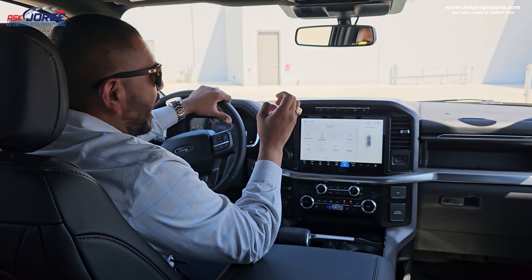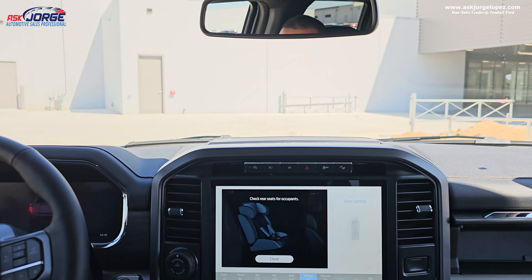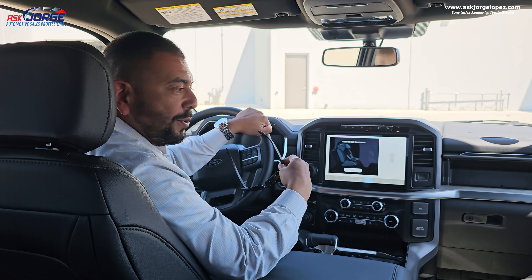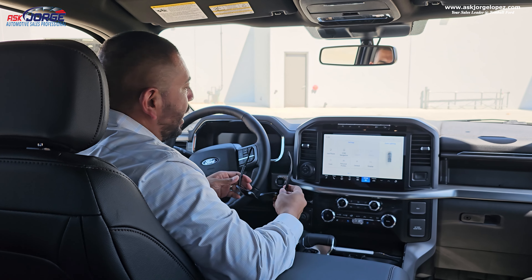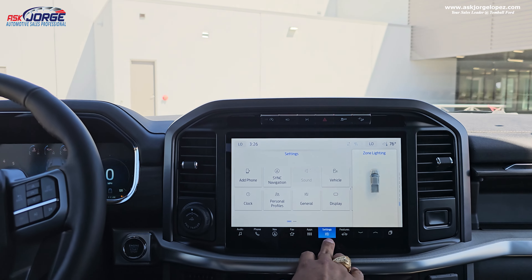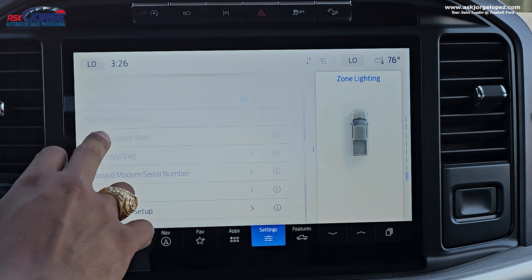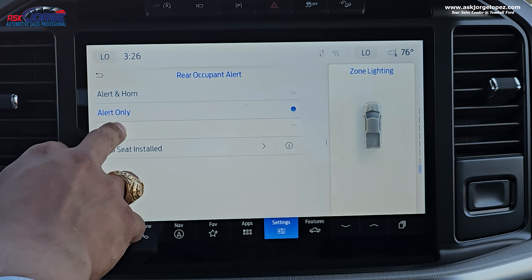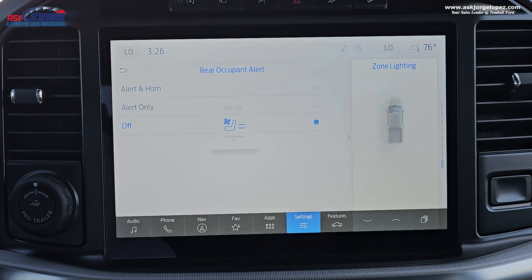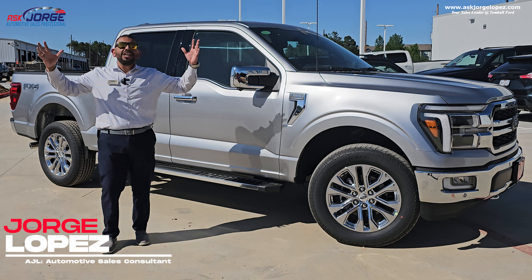There's a little tip. One customer told me he did not know he could turn off that message that appears every time he turned off his truck. The message is the rear occupant alert — the reminder to not forget your kids in the back. It's pretty sad that a manufacturer has to put that message, but it happens. The way to remove it is simple: go to Settings, then Vehicle, and then Rear Occupant Alert — go ahead and turn it off. The system will pop up twice a year to ask if you want to turn that feature back on.